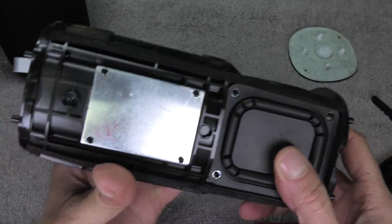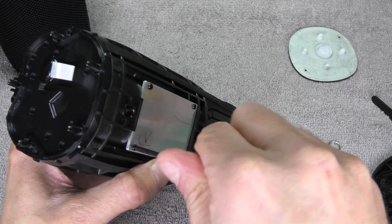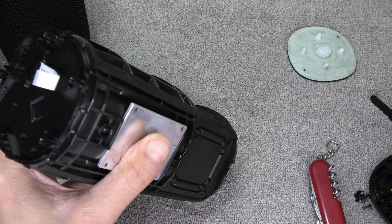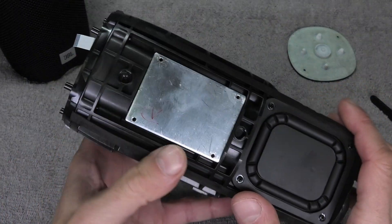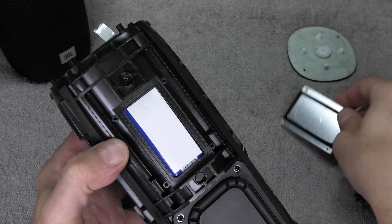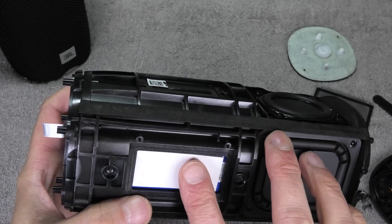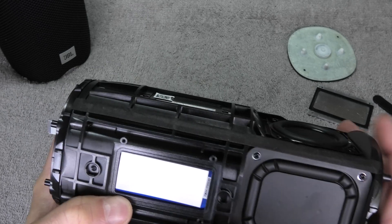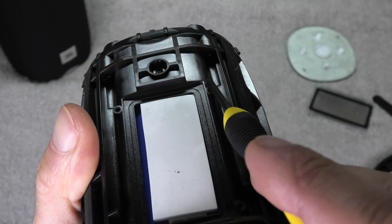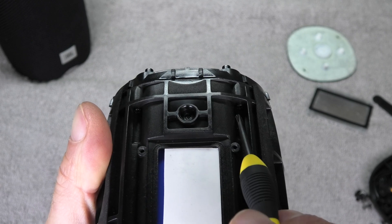Now we see here this metal plate, and underneath there is where the battery is. We can already remove this plate. Unfortunately, we cannot remove the battery through this hole that we see now. You see this white area — that's some thermal padding — and right underneath there, the blue part, that's the old battery. We can't pull the battery out through that hole, so in order to do that we have to remove two additional screws in these two slots on the left and on the right where I'm pointing.